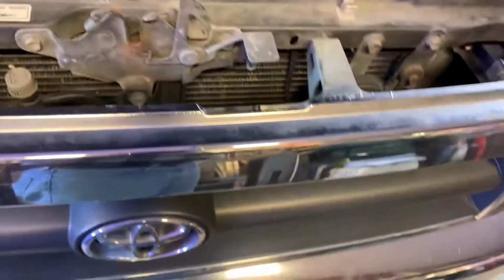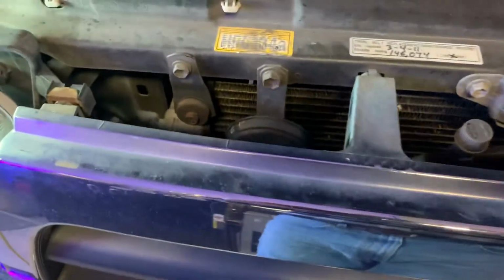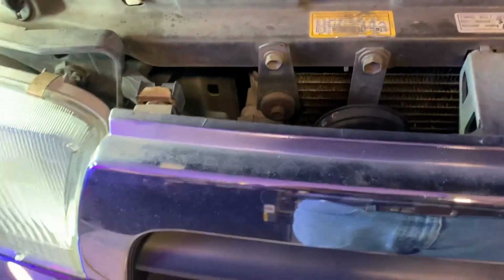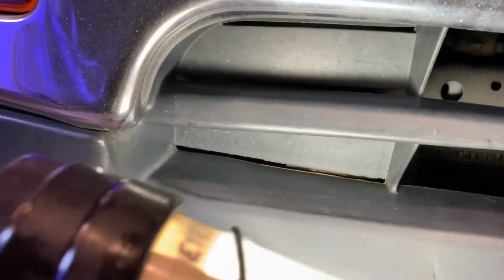And then for the bottom, I just used a universal joint extension to reach over there, and I was able to go in from there's like a, so there's those blanks in right there, so you can't go straight in at the bolt, but you can go in off to the side a little bit, and with a U-joint you can get on it pretty good.